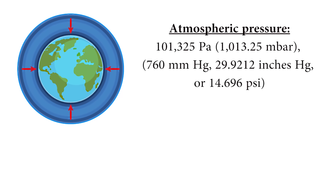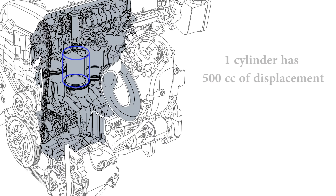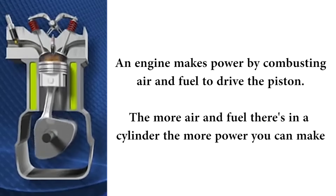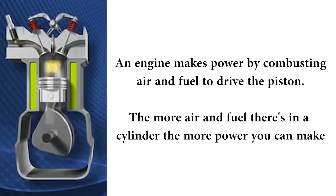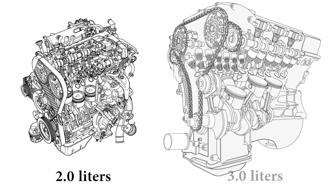This compression of air is what helps turbocharged engines make more power. At atmospheric pressure there is a certain amount of air in a given volume. For example, if your engine has four cylinders and two liters of displacement, one cylinder has 500cc of volume. At normal atmospheric pressure, imagine there are one million molecules of air in that single cylinder. An engine makes power by combusting air and fuel — the more air and fuel you have, the more power you can make. You can increase power by increasing cylinder volume or adding more cylinders, but the new engine is heavier and larger.